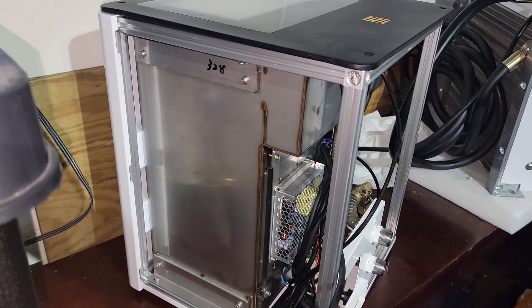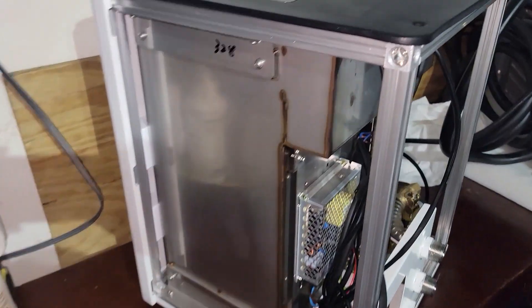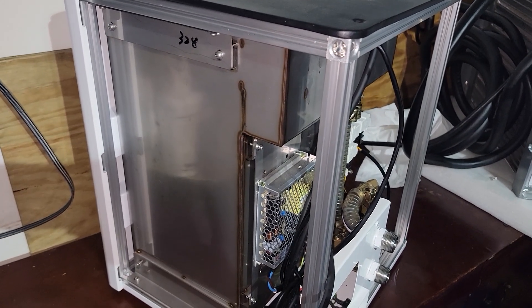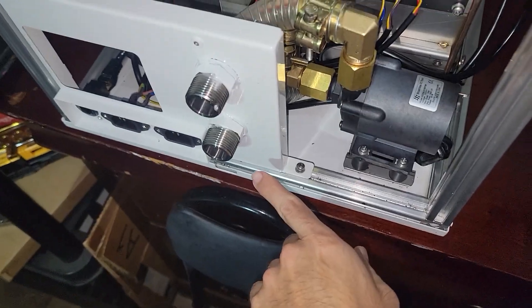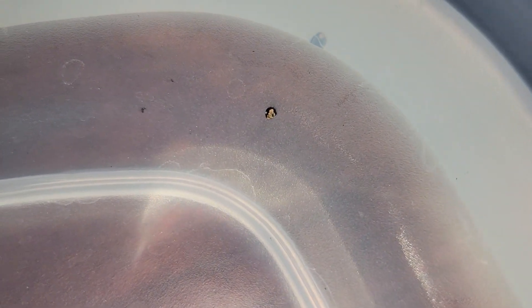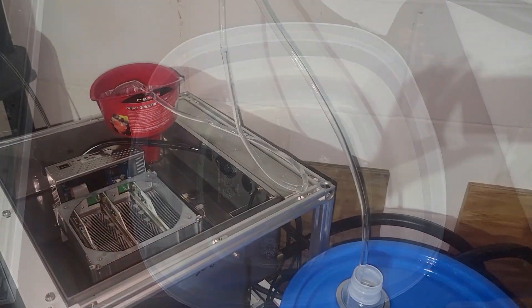I might call a couple people before putting the ASIC back in, considering the amount of thermal paste that leaked out. Oil and thermal paste grease don't go well together, and I haven't seen that with standard good thermal grizzly-type paste. Looking at what I drained from the bottom port — it's shiny and much bigger than the other particles. I'm not sure if that's part of the impeller, but it's definitely big enough to cause an issue.